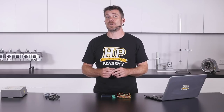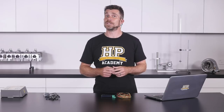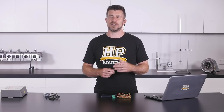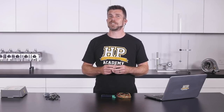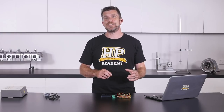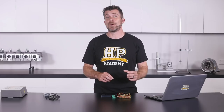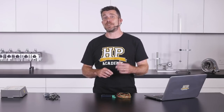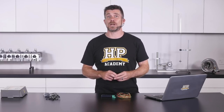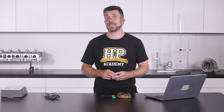This is where the smart alarms on the Micro SDM come in. For example, you can set up an alarm for engine coolant temperature within the software, and that alarm will display and flash the RGB LED to bring the driver's attention to something being wrong. The driver can then instantly look at the unit to see exactly what that alarm is, concentrating on driving the car until their attention is actually needed. Another feature on the Pro version is that it includes 32 megabytes of onboard logging. All monitored parameters log into the internal memory and can be downloaded via laptop for analysis with Plex's own data analysis software package.